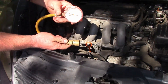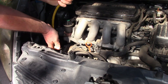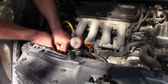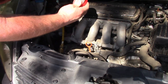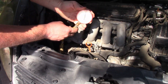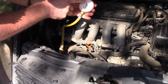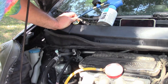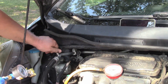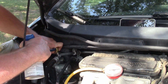Let's tap into the high pressure side — take the little plastic cap off; everything should be nice and clean. For the low pressure side, I'm going to evacuate the line as I connect it, just to limit how much moisture we're adding to the system, so I'm going to squeeze the trigger as I install it.